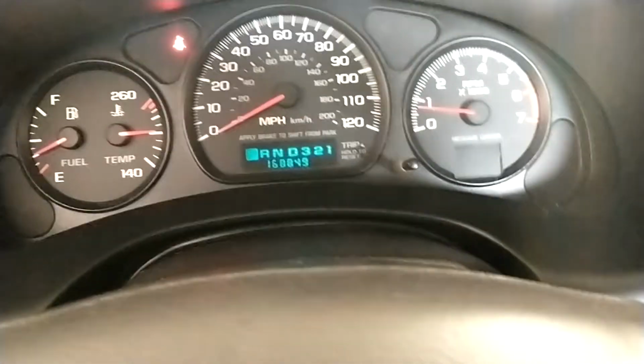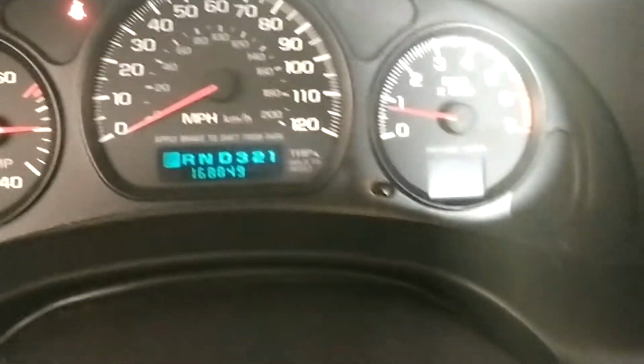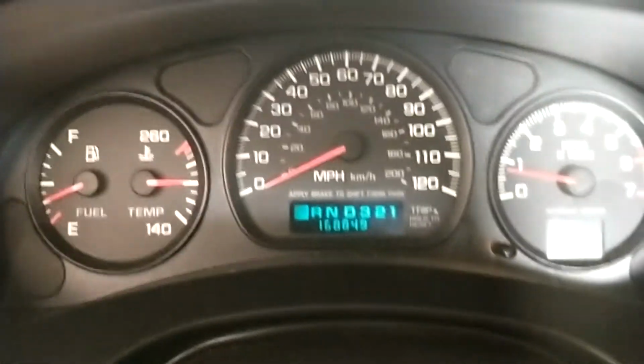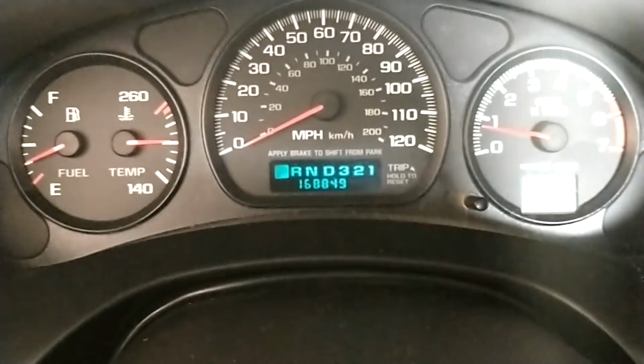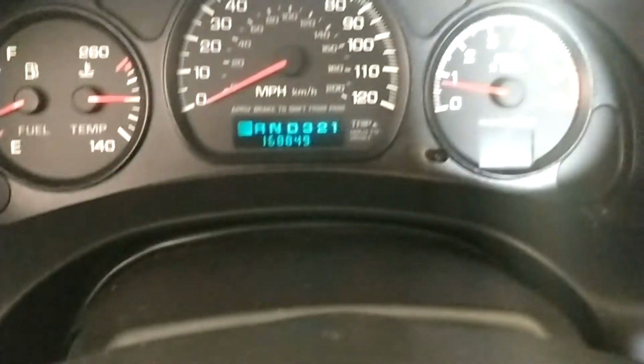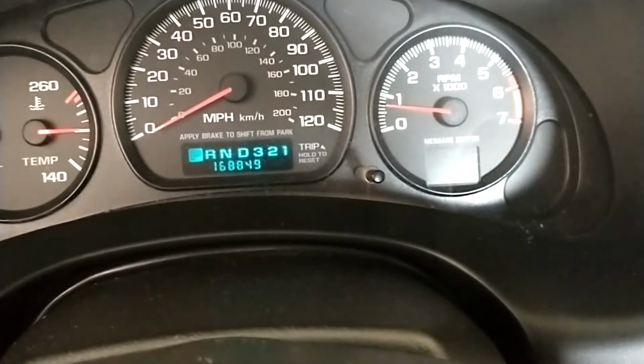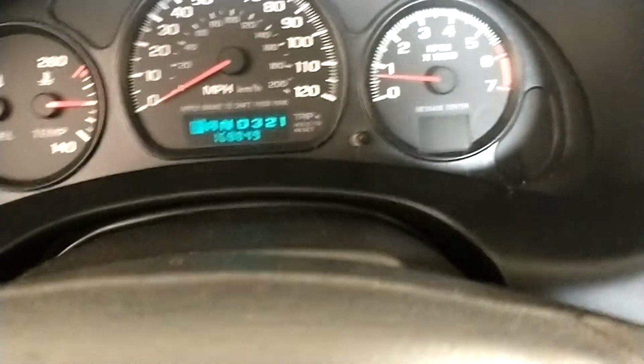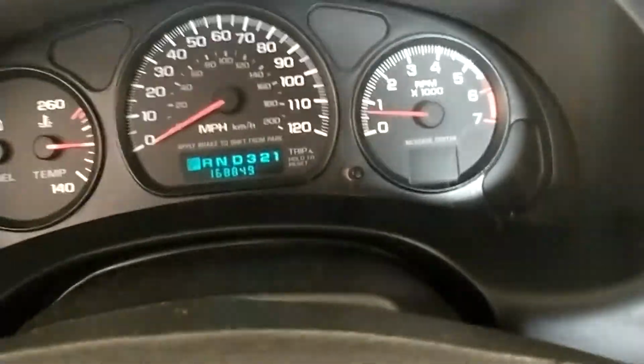Okay, we're back. Now, here's what I did. I plugged in the sensor, and even though it'll probably trigger it because the wheel bearings are loose until I change them, it probably won't. But anyway, the ABS is off. All I did was plug a sensor in. That's why when you buy used cars, you got to go check other people's work, because somebody changed the axle and they didn't plug it back in, but it was still going to trigger anyway.